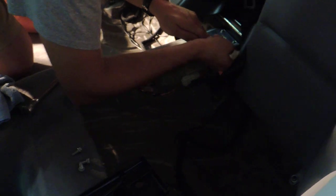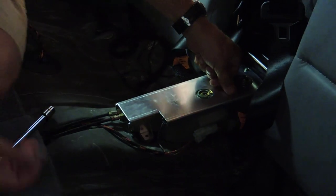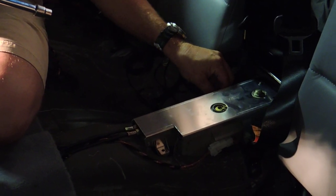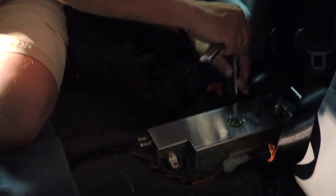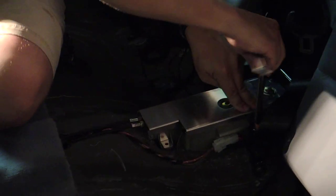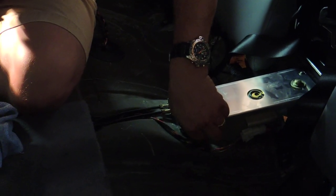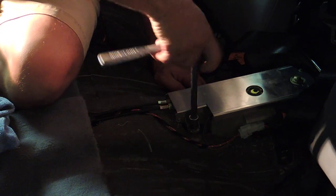Right there. I just want to make sure that cover is not interfering with that cable I ran here. It's a cable from the M5, when I put in, I believe it's a Donovan unit instead of the factory GPS unit, that I had to run that cable. Okay, we'll just tighten up like that. I'm going to tighten up the rear bolts first. Just not tight, just a little snug. And like I said, they weren't too tight. I mean, they came out real easy.